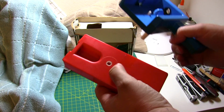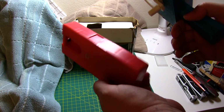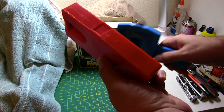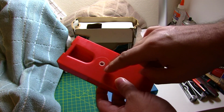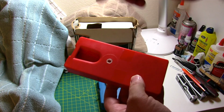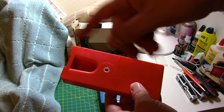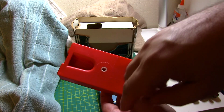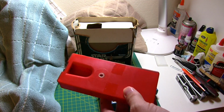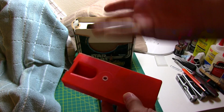You can't tell, but I opened it up. I put some tape on it. You might be able to see it in the video there. I opened it up to see what the heck was wrong with it, and there is a plastic gear in here. It's basically film inside, with the little notches that the cam or whatever gear goes through that turns the film, and all the teeth are just totally gone off of the gear in here, so it will never work.